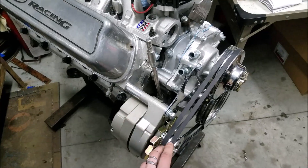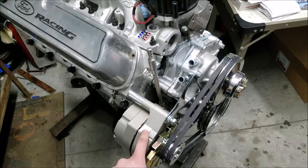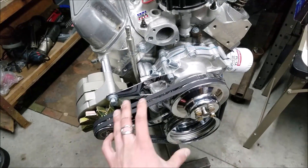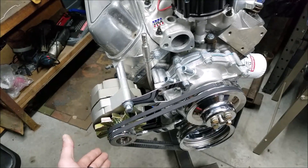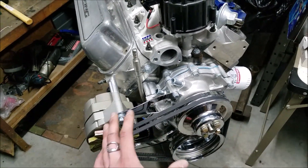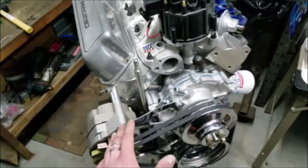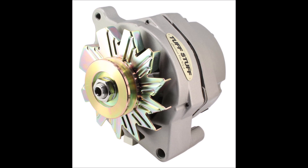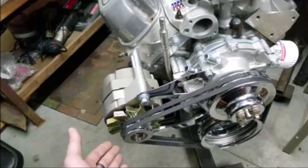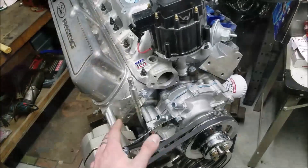Our final piece here is our dual pulley setup. Tough Stuff sells this, and if you are running one of these one-wire alternators I highly recommend it. With a single V-belt and a 100-amp alternator, they definitely squeal at startup — I've seen that. The Tough Stuff alternator comes with a single V-belt pulley, but they do offer a dual V-belt pulley, which is what you see here. I highly recommend purchasing it, as that one single V-belt won't handle the 100-amp load without slipping during high amp draw scenarios at low RPM. The pulley part number is listed below.